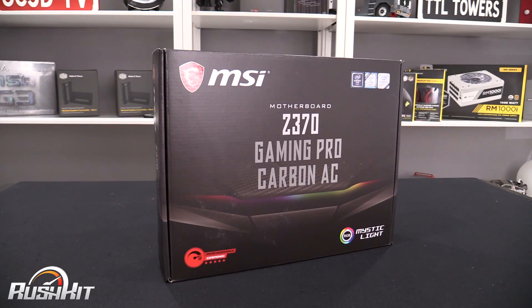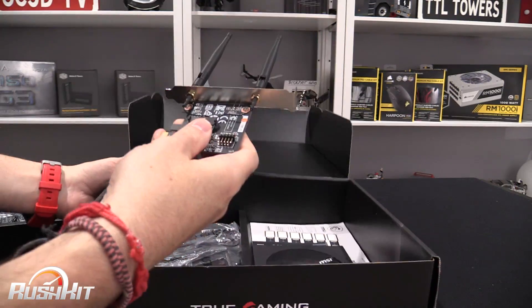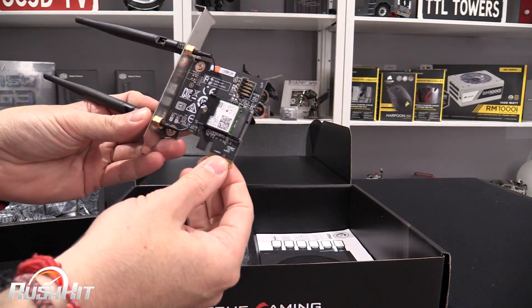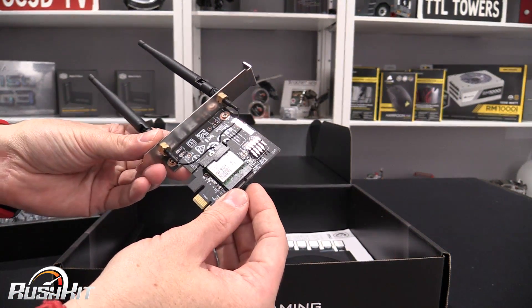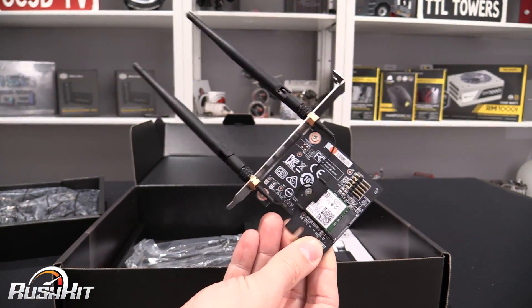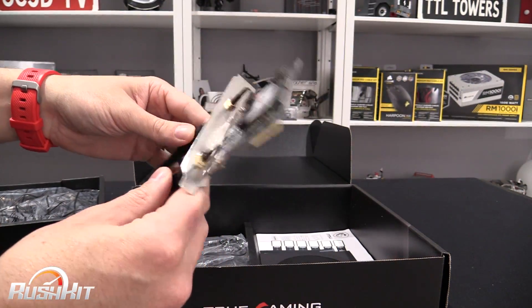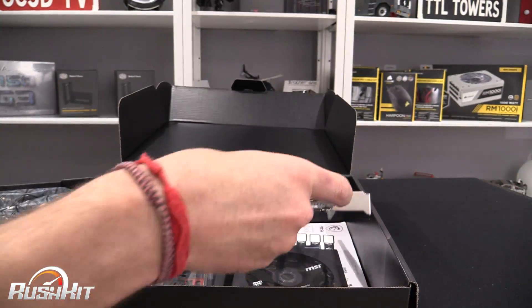We have done a preview of it if you're watching before — obviously I'm having to record stuff ahead of time. I've only taken pictures of the board so far, but it does mean I have had a look inside the box, and you do get a Wi-Fi card which you have to clip in. You don't need to worry about it taking away PCI Express lanes because as long as you use one of the black PCI Express 1 slots on the board, that actually uses PCI Express lanes from the chipset. So the lanes from the chipset are the same sort of lanes you'd be using for your M.2 ports. It is going to take up an expansion slot at the back though — I don't particularly like that, and I'm not the greatest fan of wireless anyway.